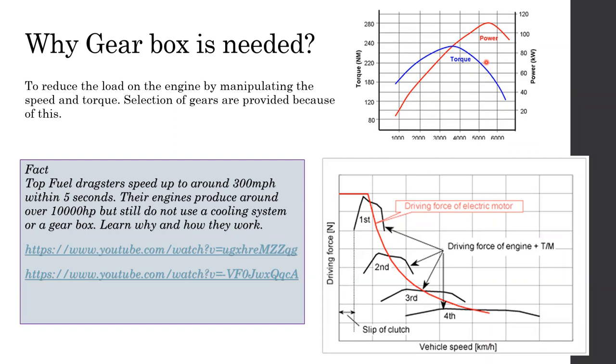So what you have to remember is that internal combustion engines, these piston engines or reciprocating engines, are inherently problematic, right? But because of their problems, we only come up with a torque and power curve similar to this. So this torque curve is not going to match our force requirements, right? Torque means force into distance, Newton meters. That's how the force is applied on the ground.